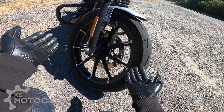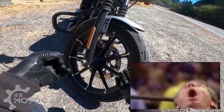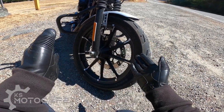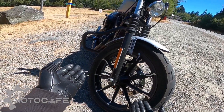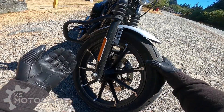If you increase that to two discs, now you're giving the bike twice the braking power as well as twice the surface area for brake heat to dissipate from. It is obviously more advantageous for a bike to have dual disc brakes. But why won't all bikes be made with dual discs? Weight plays a big factor — adding a whole new brake disc adds weight to your bike, which also plays into performance.